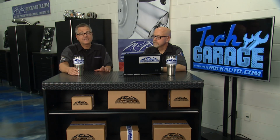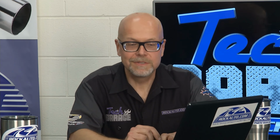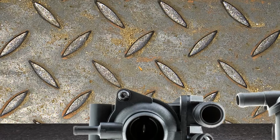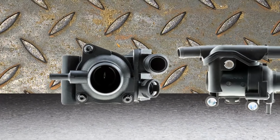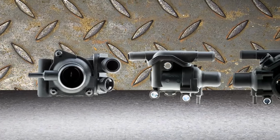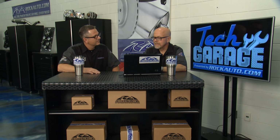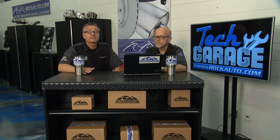Now, I mentioned earlier, anytime you overheat a car, replace the thermostat. Problem is, some of these coolant housings, man, these things are apparatuses. Yeah, plastic started being used on a lot of vehicles, and they may have multiple nipples and be very complex. I pulled up the 2001 Ford Focus as an example. You can see just how complex these things are. The replacement ones are often better with metal reinforcing in the fittings, so you can't overtighten them. A neat little trick that I know of is to put them in boiling water before you install them. Maybe that limbers up the plastic a little bit. You're less likely to get a stress crack down the road. Yeah, and torque specifications are key. Stick around. There's plenty more Tech Garage right after this break.